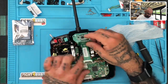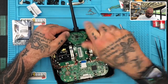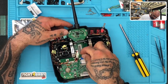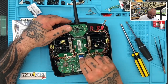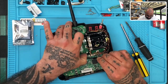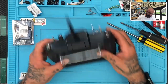Now let's go ahead and put this back on — it's fairly easy, actually. Only 27 screws total, so that should make it very easy for everybody. I am in turbo mode today, so hang tight as we zoom through the rest of this work. Let's put our three screws back in. Put the ribbon back in, and remember make sure the brown clip is out, then push the ribbon back in — use tweezers to make sure it's in properly, then push the brown clip down. Now come in here, put our red and black back on. Put everything back, and look at how nicely that goes back together.